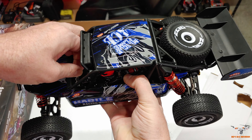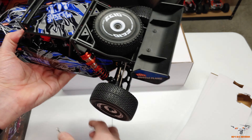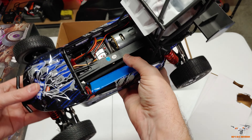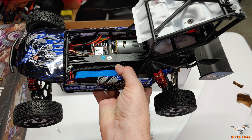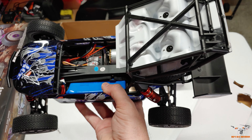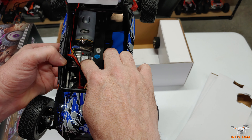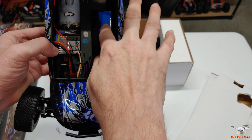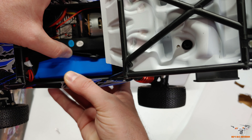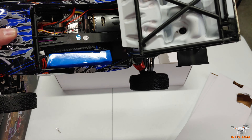So let's go ahead and pull out the body clips here and take a look underneath the hood, so to speak. It looks like it just pivots up — and there you can see inside. It's a lot like all the other ones in this style; I don't think the whole body comes off easily with the clips — it just pivots up, whereas on the other car you could pop the whole body off. And here is that big 550 brush motor. Here's your ESC receiver combo. I believe this is your power button. And here is your LiPo battery, which is a 2200 milliamp, 7.4 volt — so 2S — the same LiPo pack as the other version uses.